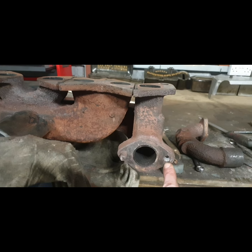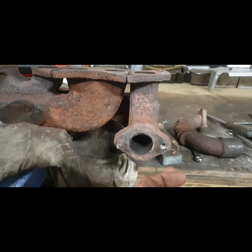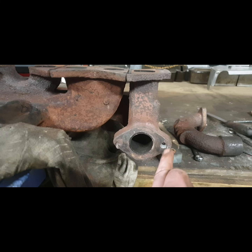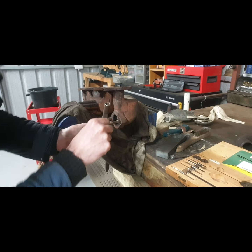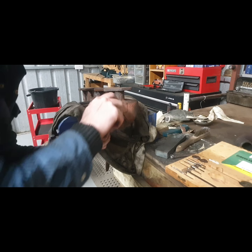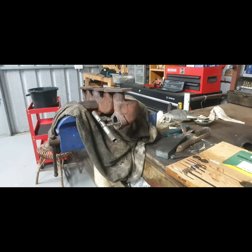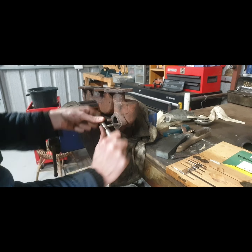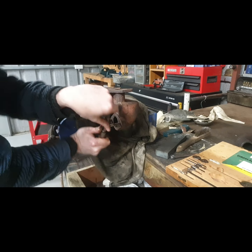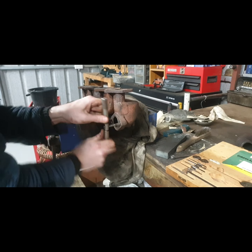I drilled this just a little bit too small of a hole, so I'm going to slowly work at it to get it more centralized. I might even use a round file, and I might try a little stud extractor just to see if I could get it out, because I haven't actually damaged any of the threads. So I've been drilling through it and now I'm going to make sure it's going in nice and true. That's just the first step — cleaning things out. Cooking away lovely.